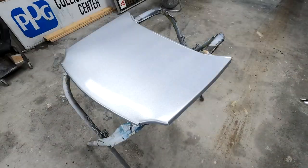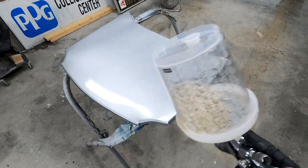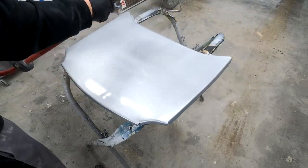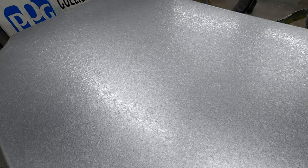Incredible flake size on this. Now we've got the tropical glitz mixture for the crystal effects and we're running it through the mini jet. You can see we're just adjusting air pressure — I like to do two light to medium coats. This stuff dried in about five minutes. Now it's kind of hard to see right now, but once I put the black base coat on and knock it back you'll be able to see it a whole lot more. I like using low pressure across the side. The main thing to understand is that the faster it dries the smaller crystals you're going to have, and the slower it dries the bigger crystals. I had some fans on so it dried out pretty quick, giving us some of the smaller crystals.